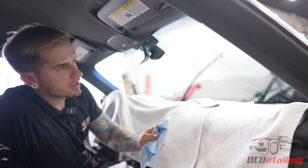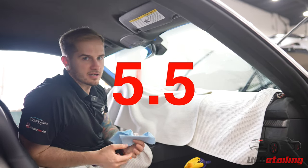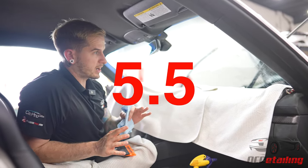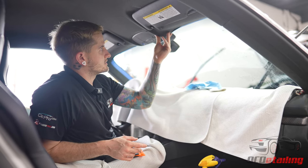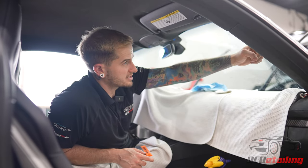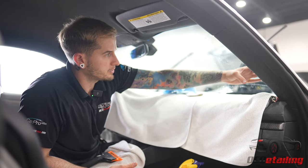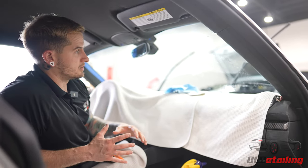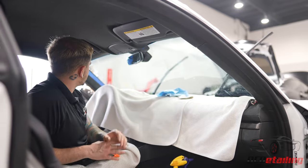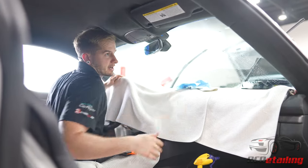Alright Justice, what do you rate this windshield install zero to ten? I would say this is a five or six — a good medium. The rationale: this is the same for Audi and Porsche windshields because they're almost identical in how they design their moldings. This one has an argyle texture around it, which adds a level of difficulty. Then there's how tight the edges are — Porsche is notoriously tight. I actually cut these short for them to line up just perfect, because if I get any fingering or bubbling on the edges where it's butting up against the trim on the inside, it'll pull any contaminant from behind those panels and totally ruin my windshield. That little trick of cutting it just a hair short makes it way easier, but it gives you no room for error when installing and getting it placed — if it slides just a little bit either way you have a light gap. So that's what gives it that five or six.